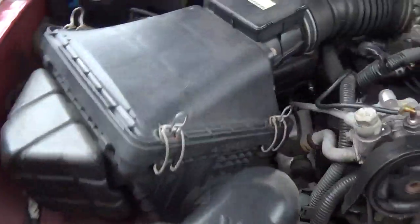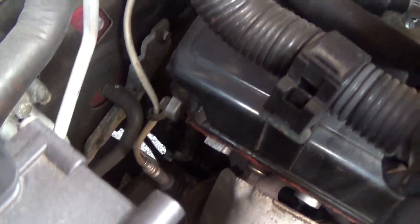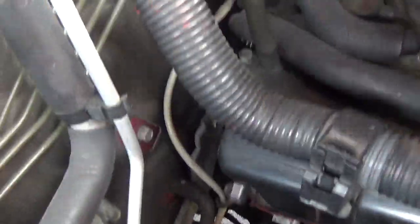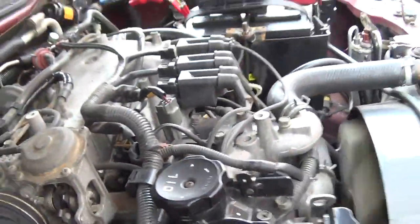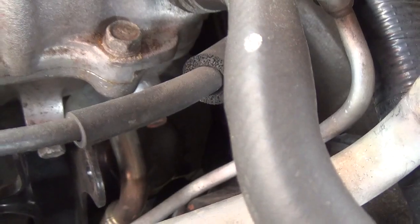First thing I noticed — someone's been here before. There's RTV sealant on that valve cover gasket. There's still oil leaking onto the exhaust manifold there. The O2 sensor lives right there. You can do a visual inspection of the harness — everything seems to be pretty okay. That upstream sensor looks pretty fresh. Remember, the O2 heaters are powered by this relay, and that's where a lot of heat and vibration is — cam, crank.